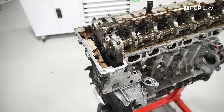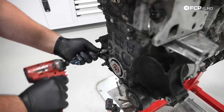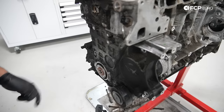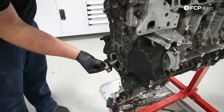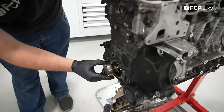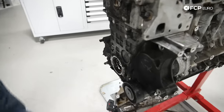So kind of simple, but when you hear about S55 engines, for example, spinning a crank hub, it's because the tension was lost on this bolt somehow. These little bolts here hold the timing guides in place. Just gonna pull them. And everything fell down. But this is the crank snout. So that physically bolts to the front of the crank and it holds your oil pump sprocket and the timing chain sprocket to the crankshaft. We'll show you a little bit more once we get everything pulled apart.